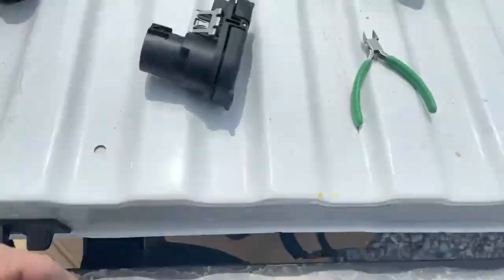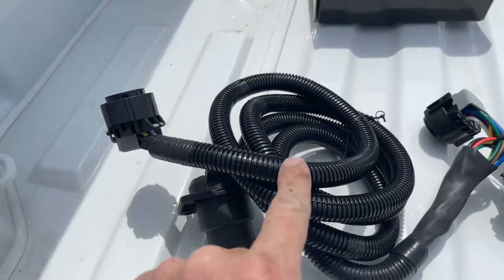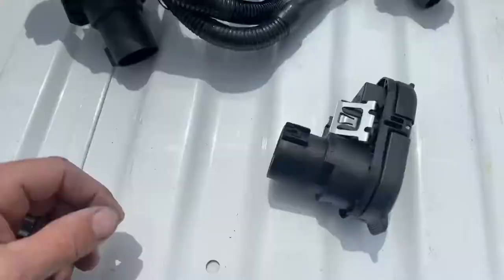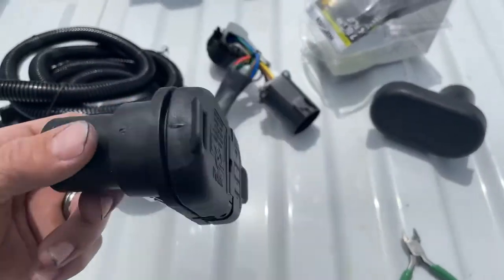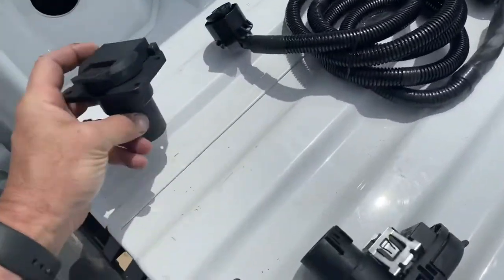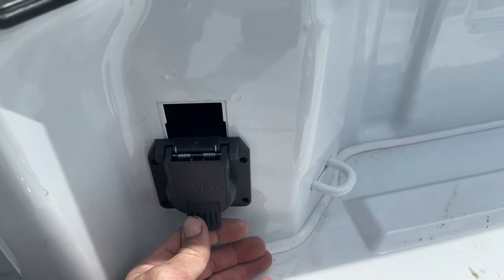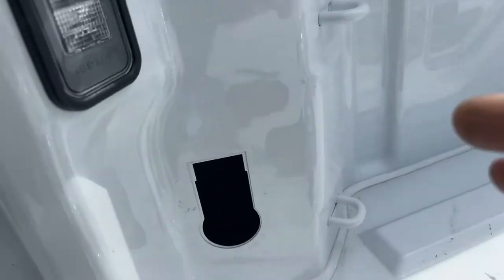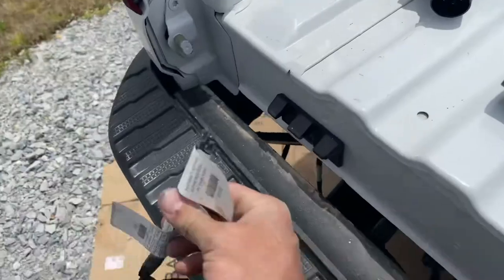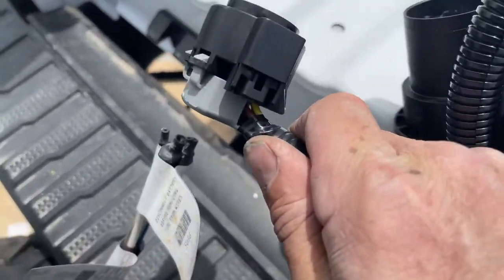You can get one of these with like a 12-inch lead where it comes down about 12 inches and then it's bare wires. You hook those bare wires to these bare wires so that you have this end and then this to plug into that — and you're spending twice the amount of money that you normally would on just a standard 7-way plug in the bed, just so that you don't have that gap above the plug. The easy fix for this is just to make that a round hole for a regular 7-way, and just provide the OEM plug on the back of it.